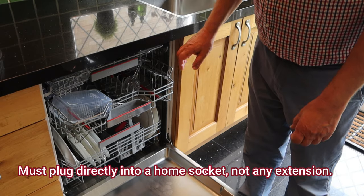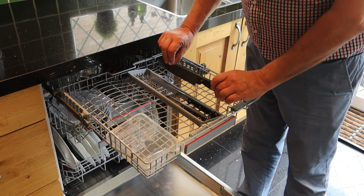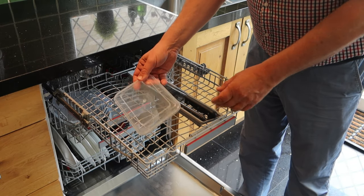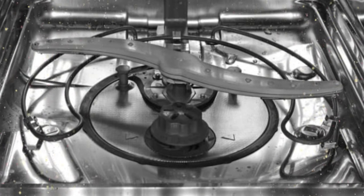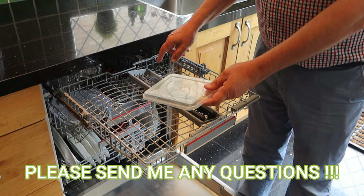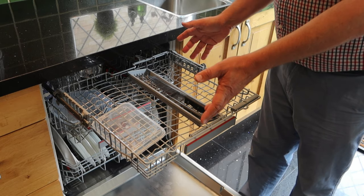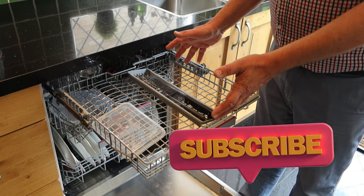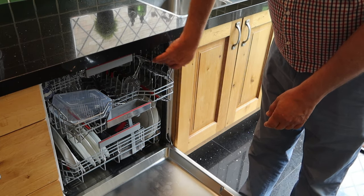In a lot of new machines you'll find a third tray at the top. This is a good place for big knives and small espresso cups. Lids are okay there too. If you use an older dishwasher be very careful with plastic, as older dishwashers often have an exposed heating element in the base and plastic items that fall to the bottom will melt onto that element. The top tray will still sterilize everything — it doesn't give as big a wash without its own arm, but it still sterilizes things like teats and baby bottles.